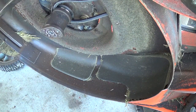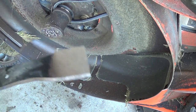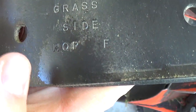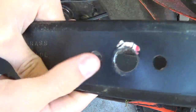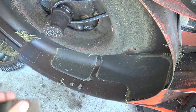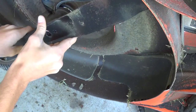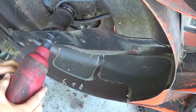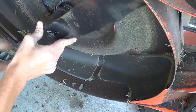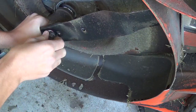So these fins go up like this. When you have the mower on its side, it's also a good idea to knock the crap off the bottom. I wouldn't pay 20 bucks for this blade — I can get them cheaper. Grass side means this side of the blade will be hitting over the grass. You want to put it with these fins facing up toward the mower, or with the sticker facing up toward the mower like this. Make sure you get it on those little nubs, or they'll be in for a world of hurt. You want the trailing edge — this fin — facing the top of the frame.